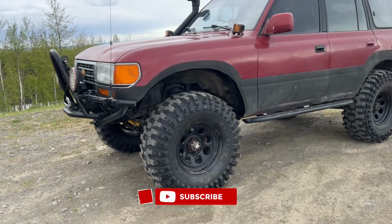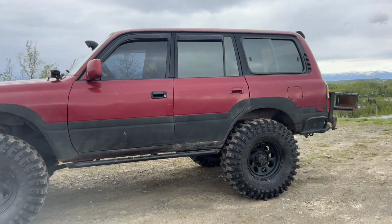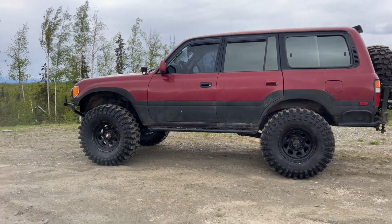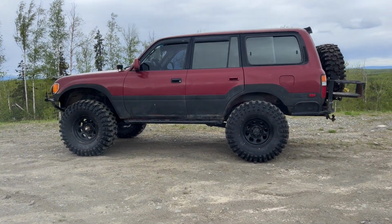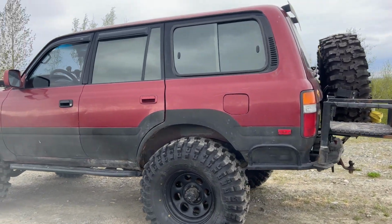This is a non-triple lock, but I do have a Grizzly rear locker and an E10 front E-locker installed on this rig. We're currently on the Old Man Emu J series lift, which is roughly a 3 to 4 inch lift, along with 1.5 inch Metaltech front spacers. Super simple, easy lift, nothing crazy, but again, very nice setup.